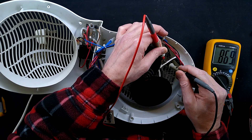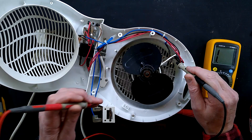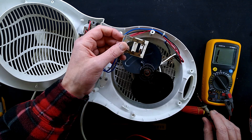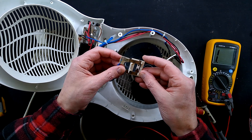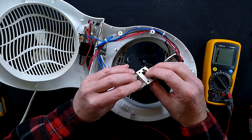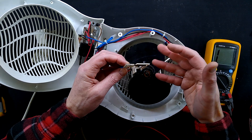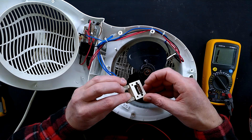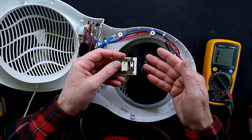The thermal fuse is fine. Alright, I'm going to try and clean these. But here's a thing - aside from the fact that he's probably had this out in a garage or something and it's corroded, if these cycle too often, if you do cover the heater and it cuts in and out, the contacts tend to fail very quickly because they're not rated for many cycles.